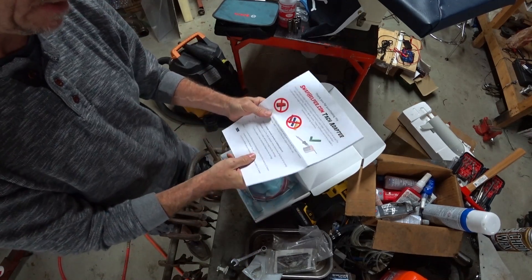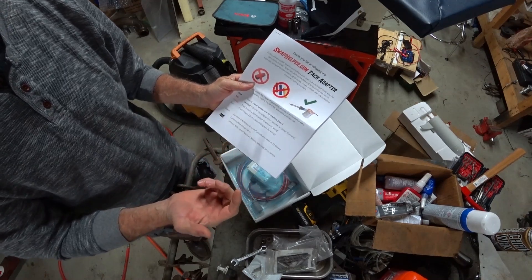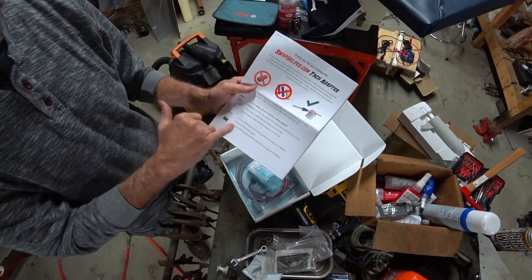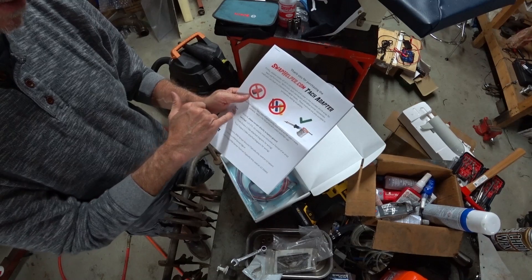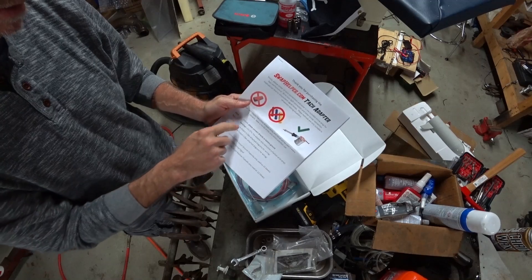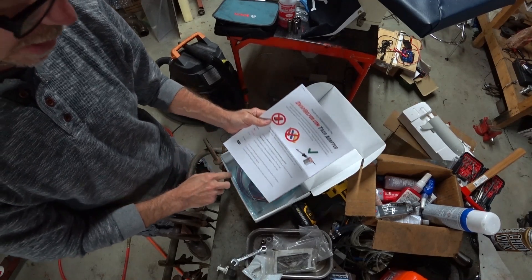I'm going to gather up information on the Cummins engine. I've got a 96 Cummins engine, which I'm going to match up my Hall sensor to, so I can tell what wires I need to cross reference to hook these up correctly. I'm also going to get a wiring diagram for my 08 F250 so I can tell where I want to place these wires and match everything up.